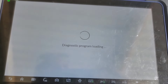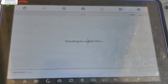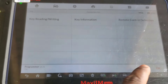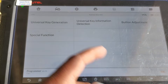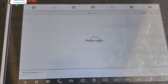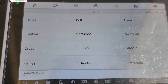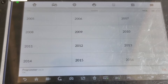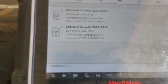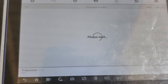The first step is to generate the i-key. Once you use the i-key you have to generate it for the actual vehicle or key style you're using. We go to Programmer and Key, then select Universal Key, then Key Generation. We pick North America, then go down to Chevy, go by model to Corvette, and there's our year 2014. We pick the one that matches our existing key and select that one.